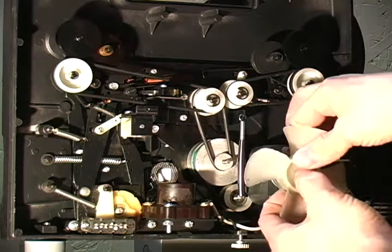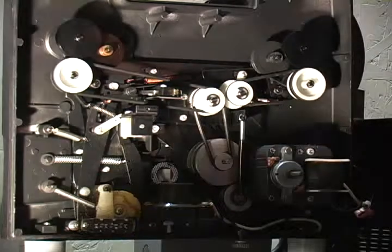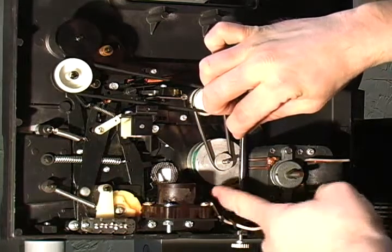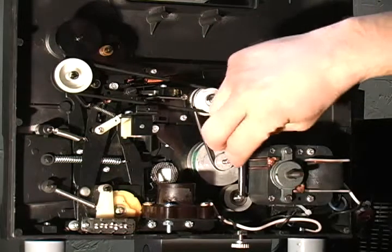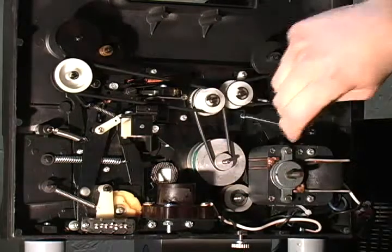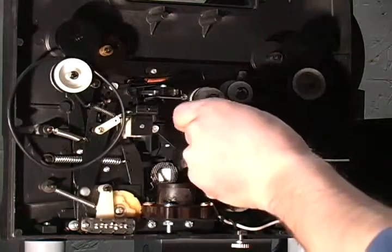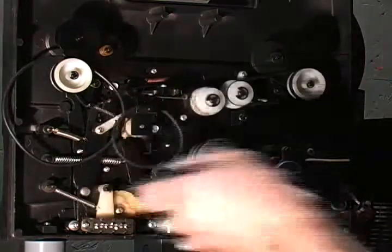First thing I want to do is take off the fan — it just pulls right off, get that out of your way. Next thing is you have your spring here. This spring basically just holds the bottom pulley up a little bit, giving it slack so that it can spin free without the shutter actually engaging yet. So I'm just going to grab it and pull it out of the way. Then I also have to get a few of these other belts out of my way — pull that one off, and then this one here we're going to pull off as well. Just bring it around and get it out of your way.